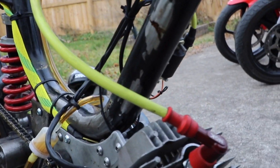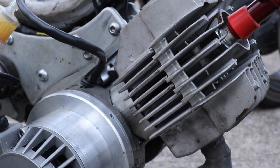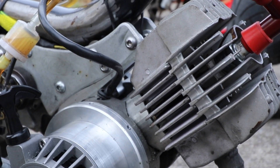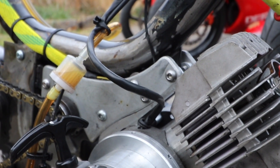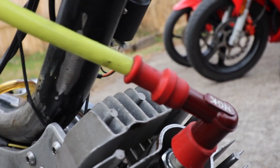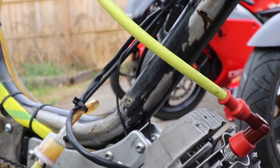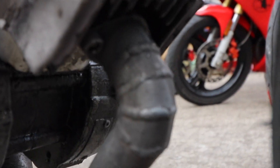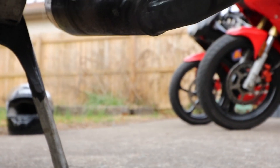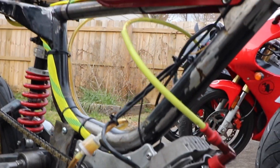You made the spacer for that crank? Motor mount, the spacer, that whole thing. Yeah, intake. The head — I took a head but then I machined it, like redid it entirely. Is that like a puka head? Yeah, maybe. It was just something on Treats, only like 30 bucks, but I machined it the way I wanted. So the compression is really high — I don't know what it is but you definitely feel it when you pull on it.